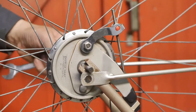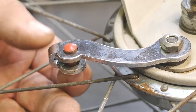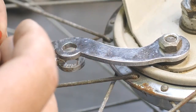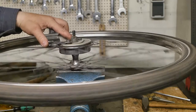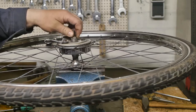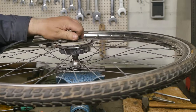And now the wheel should come out. I need to be careful that I'm not going to lose this little plastic piece, so I'm taking it out. Let's put this wheel in the vise. The front axle doesn't have any flats so I'm holding it in the vise with a jam nut. And that might start to spin whenever I take off the jam nut on the other side.